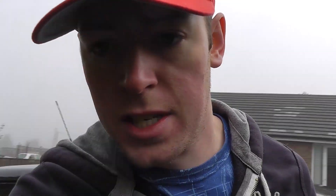You have to have a rough idea what you're doing in the first place. I wouldn't recommend getting one of those eBay tuning files and sticking them on. People are putting ECU flashes on for engines which are similar but not right. For example, this is the Polo 1.4 TDI. There's an Audi A2 with a similar engine, but there are people flashing maps from the Audi onto the Polo. It's crazy talk.